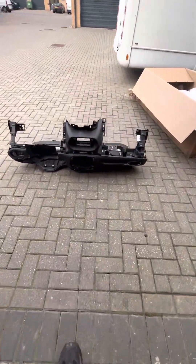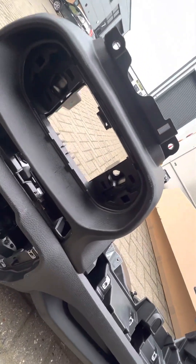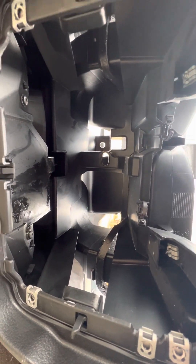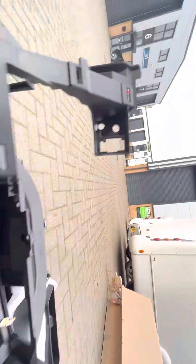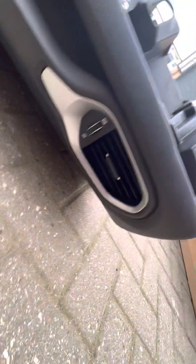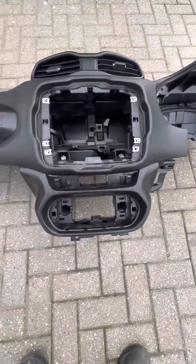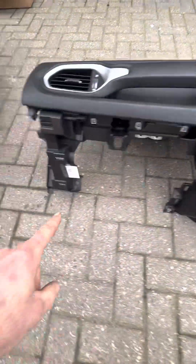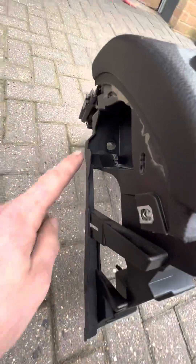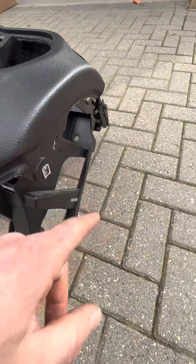I'll show you what it looks like — this is the one I took out. In that module with the three dials, there's two in there. There's one behind the stereo, one on the back of the dash mount, a couple on the side bits that stick down, and there's one in the corner — there's that fan mount, pretty much the same on the other side. You've got two in here, one in there, one on the leg, there's a sneaky one on the side of the leg. When you take that side panel out, it's a lot more obvious. Same on the other side — one on this leg, one in this bit here. That doesn't have to come out to get it out. One at the back of the speedo — that's pretty much it for the Renegade dash, and then it does pop out.